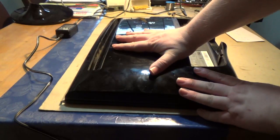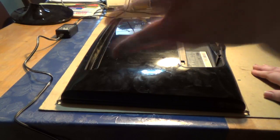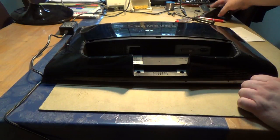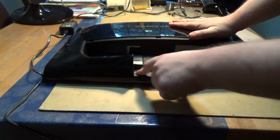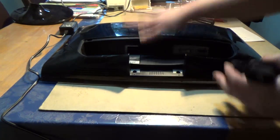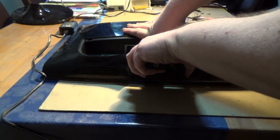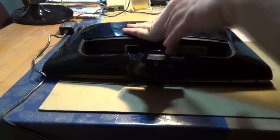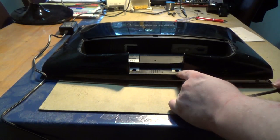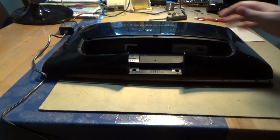What you have to do first is open the casing. It's nearly the same with the T22 and T240 from Samsung — basically the same principle with just a bit of a difference. I learned this job 10 years ago and did this a lot. There are two screws here and here. Pull really hard on the stand — I had problems getting it out, I thought there were screws in there, but there aren't any, at least not with the T200. Just pull this out, then get out these two screws. Not sharp knives, please. Don't hurt yourself.